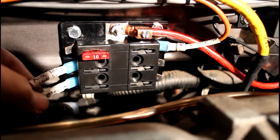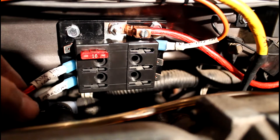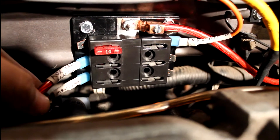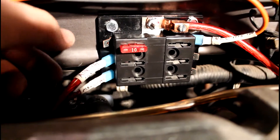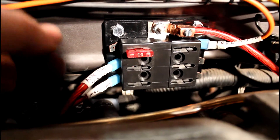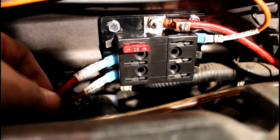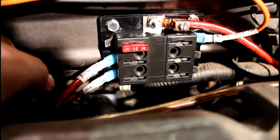I've got the Mega Squirt ECU power here at the bottom, and then I ran an auxiliary eight-gauge over to kind of the area in the floorboard. I'm going to use that to hook up a power inverter just to run my laptop, since I have my laptop hooked up in there a lot, so get some decent power in there.